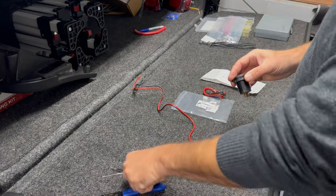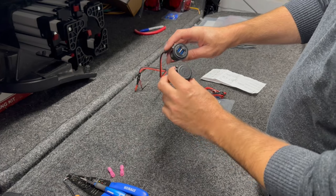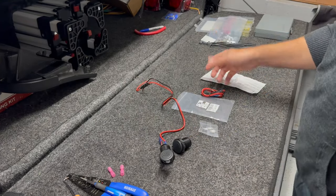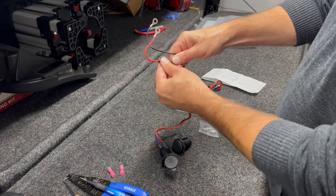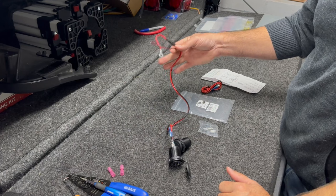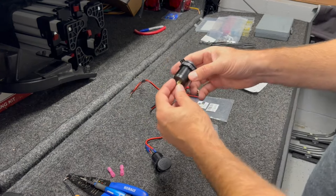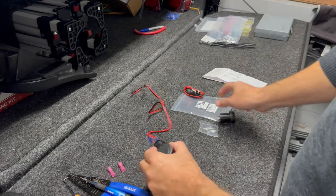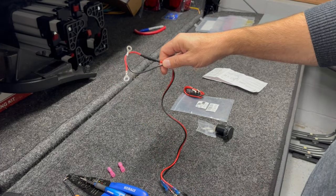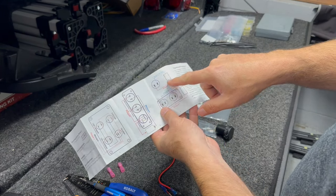As always, I'll put the link for these particular ones in the description — it is an Amazon kit. There are two of these, and there's going to be some LED that lights this stuff up, so that'll be kind of neat. Those fuse panels I have are powered with the key, so they will be dead when the key is off. This did come with a little 10 amp fuse. I'm going to cut those off because I'm using a fuse in the cart, but it does come with one — you could just go direct. For the one going in the black cart, I'm just going to put my own connections on the ends of the wire. This is plenty of wire, so I'll just cut that off, put the ends on it, and wire it in positive and negative.